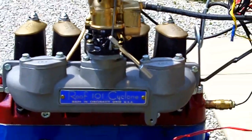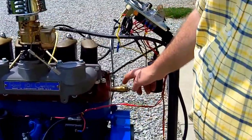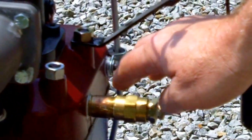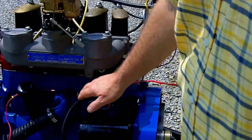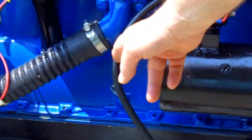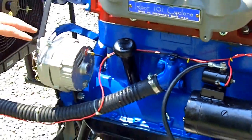This thing back here is a water temperature takeoff. We've got two of them back here, so you can have a hot water heater. You could have a temperature takeoff, or you could even do a temperature sender for your electric fan. Down here we've got the side water inlet, and it also has a boss on it so that you could add a water temperature sender or a hot water device for a heater.